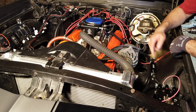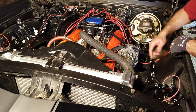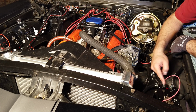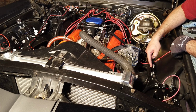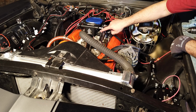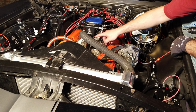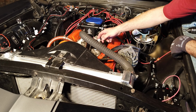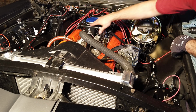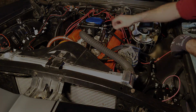The final installation of the plumbing from the FiTech Mini over to the ACES EFI. The pressure side comes out of the red port in the middle through my 10 micron filter from FiTech around into this T. The T has my fuel pressure sending unit where it's now been wired, so it has my coolant temperature sensor. It comes through here, fills up my bowls. We should be ready to go. All I gotta do is tighten these down a little bit more and we're good.